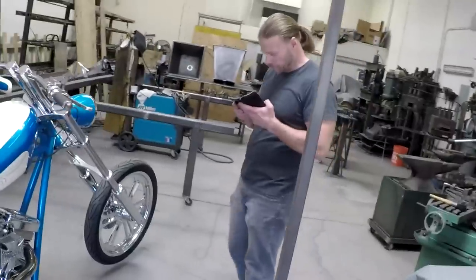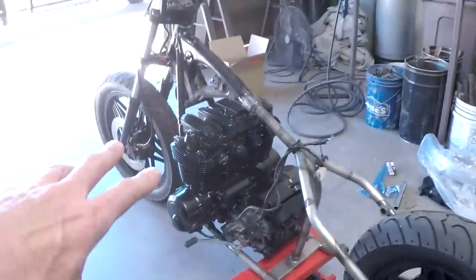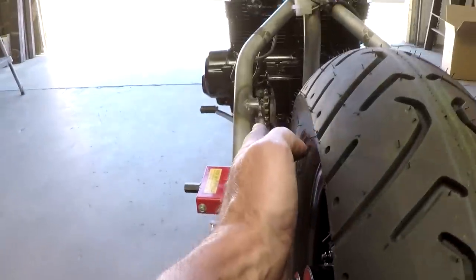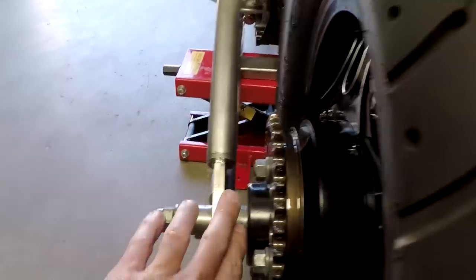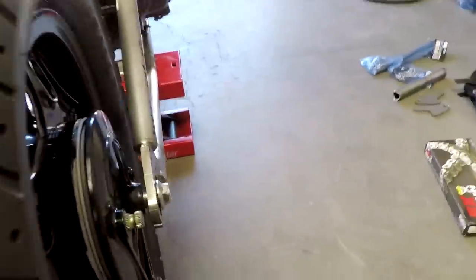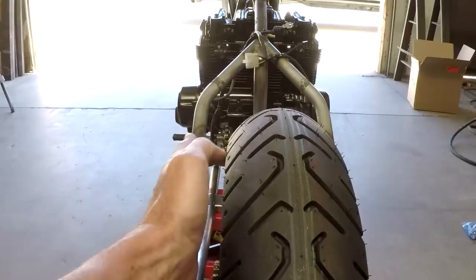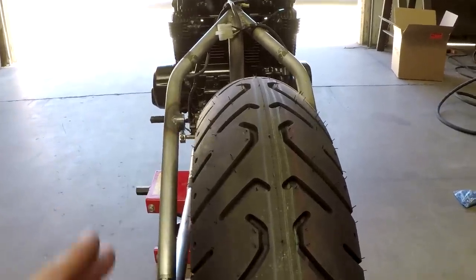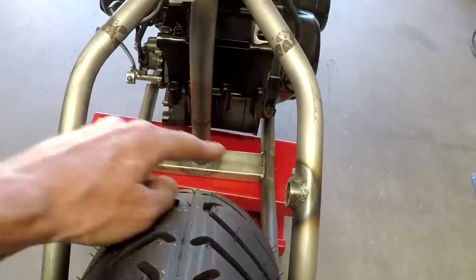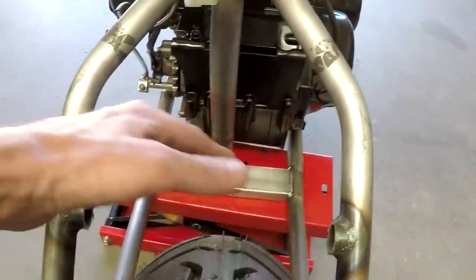All right, we're at the metal fab shop — here's Christian's chopper getting some work done. Here's the bobber. First thing we've got to do is get the back wheel sprocket lined up with the counter shaft sprocket, but the problem is this space between here is too tight. I'm going to have to figure out if I need to machine down the spacer on this side to get the wheel both centered in the frame and lined up with the sprocket. I already cut out the cross piece that was there — I'll clean this up and then weld the new one in and get the back fender in position.